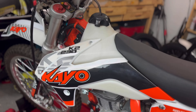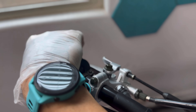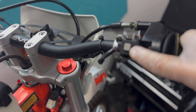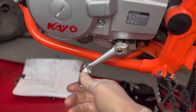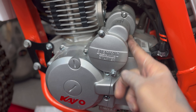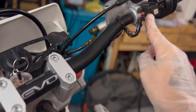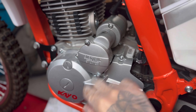The first thing I want to talk about is the fact that this bike has an electric starter. To actuate the electric starter you have to engage the clutch — you have to pull the clutch — and that's how you're going to be able to engage it. The bike has to be in neutral, which is the safest way to do it. This is your starter; it rotates the motor, the flywheel, and the clutch for you so you can get the bike started.